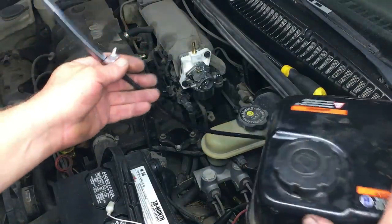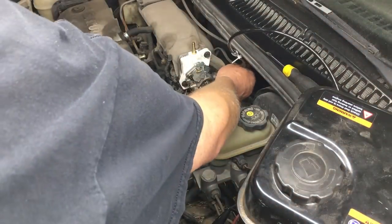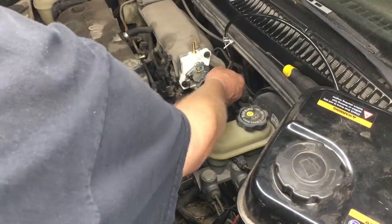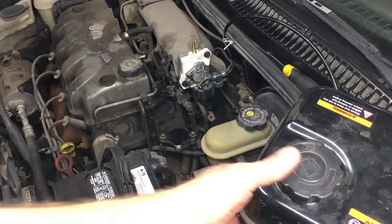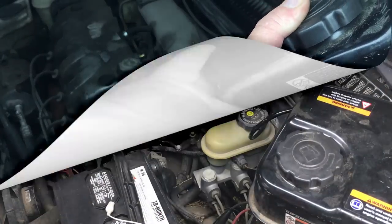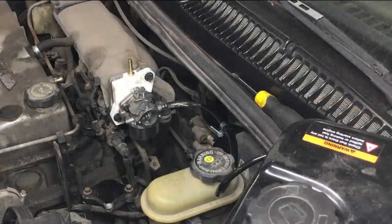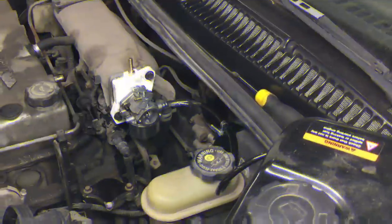For a fuel tank, we'll be using one off a 212cc Predator engine. And we won't need a fuel pump because gravity will work in this application. Off camera, I rigged up the Lone Wolf 2000 remote starter switch to the starter bypass switch so we can fiddle with the throttle while cranking the engine over. You guys ready? I am. Bring the thunder!